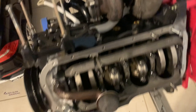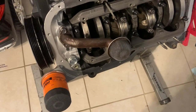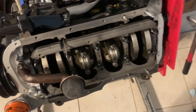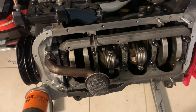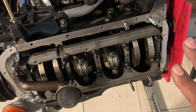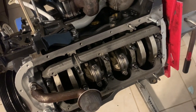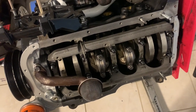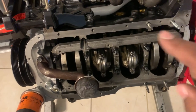I put the oil filter on there, which is just to break the motor in, so that should be good. Now we're going to put on the oil pan. I'm installing studs to make sure I put it on evenly. We will not be using an oil pan gasket for this application — we're going to use silicone.